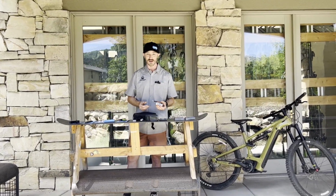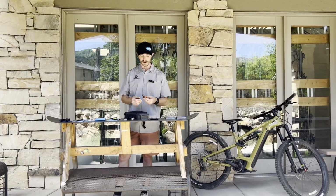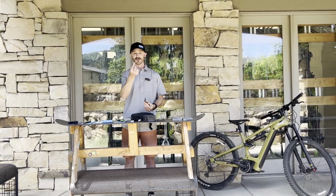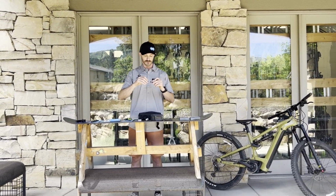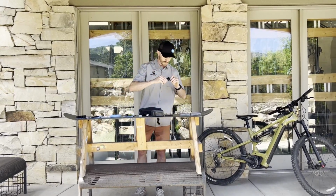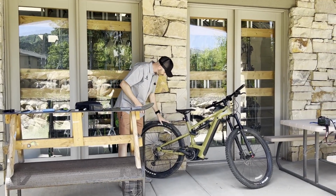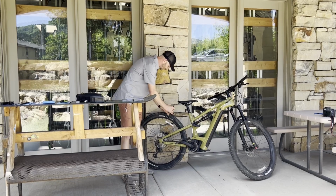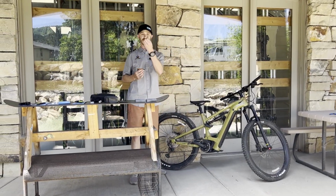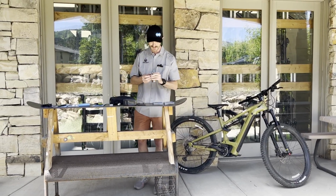This multi-tool here that we have from Cannondale is awesome. Has all of our Allen keys, screwdriver, all that stuff, as well as this Dynaplug tubeless kit. So right here, this is a vulcanized rubber patch with a little spike on it. Super sweet. If you run over a large thorn, tree branch, whatever, punctures the tire, you can literally just stab that in there, pull it out, it removes. That rubber tail plugs the hole. You're riding home. Everyone's having a good time.